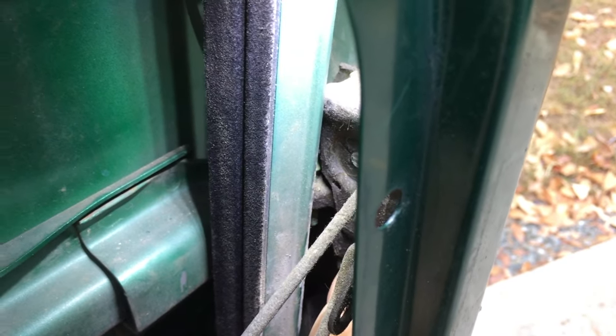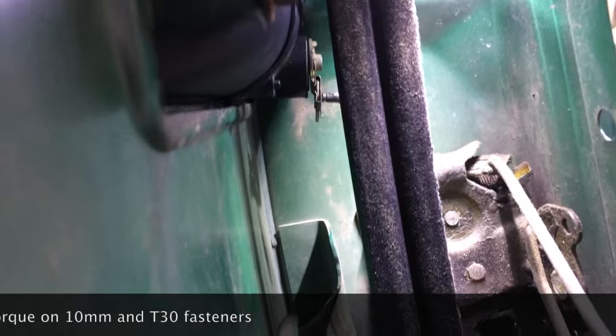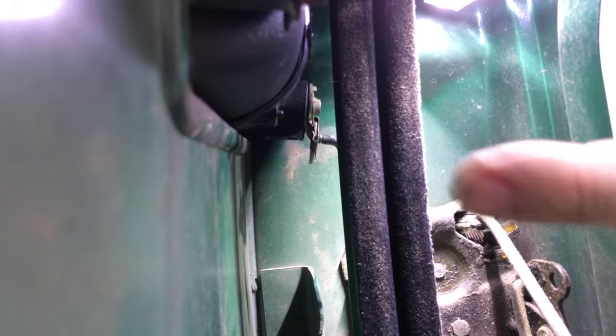You're going to torque those fasteners down to 35 inch-pounds. Now the last thing we need to do is reconnect the rod for the lock cylinder. You're going to need the keys to make this easier. You can see I got the rod lined up right with the lock cylinder. I'm turning the key now - you can see how the lock cylinder lever is moving. You just line that guy up so he's perfectly aligned, then go up in there and push it in like I showed you on the other one. If you can't get your fingers in there, use needle nose pliers to push it in until it locks. We've got this guy installed and we're going to start putting everything back together.